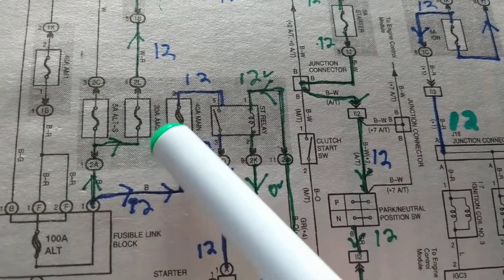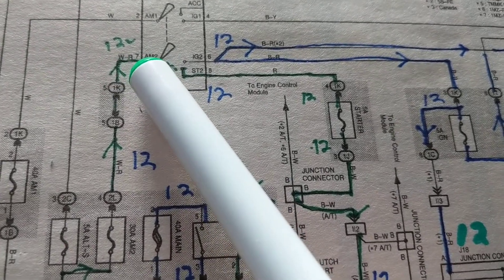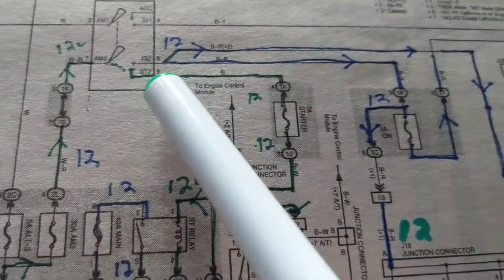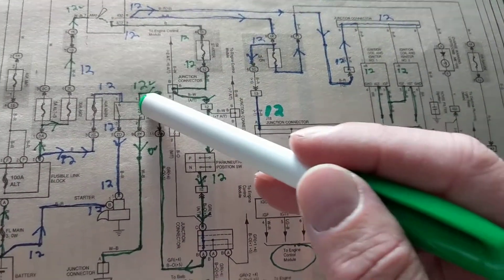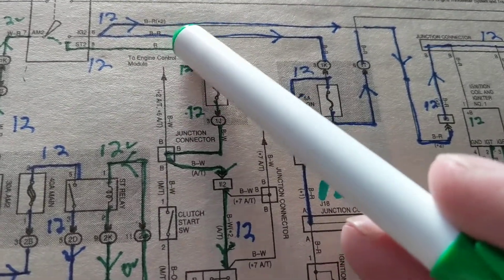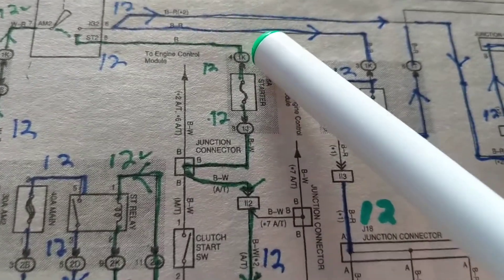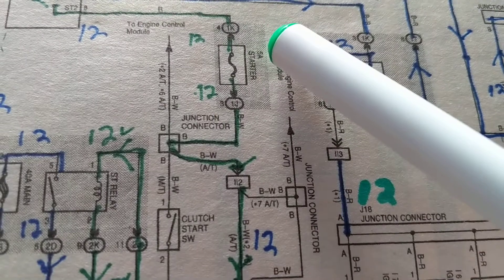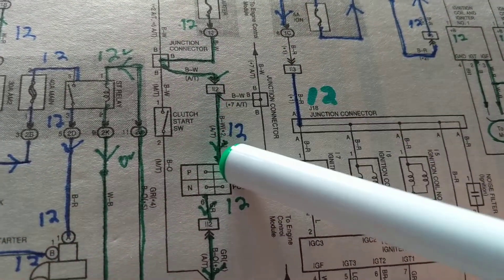Let's try this path — what we're left with. We come out here again, follow the green pin one of this block, go through a regular 30-amp fuse, white-black wire over here, through pin seven — this is the ignition switch, these are the pin numbers. We have 12 volts here. We close it, and now let's see the path we can take. We go over here — black-white wire — this is pin eight. We come in here, another fuse, pin four, pin three, a 5-amp starter fuse.